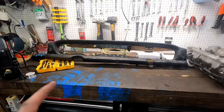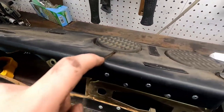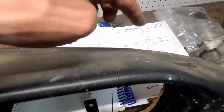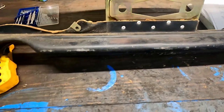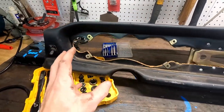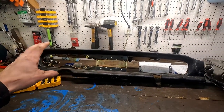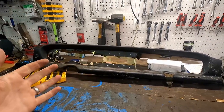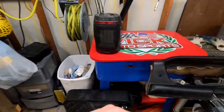We've got it on the bench and you can see just how cracked, gone, and separated this dash is - really in bad shape. To replace this, you can either spend the big money and get an actual padded replacement dash, or you can get a fiberglass replica one - I've done that before. But we're going with another option: we're bringing over an example of an old dash with a full dash cap - a plastic cap that sits on top of the old dash.